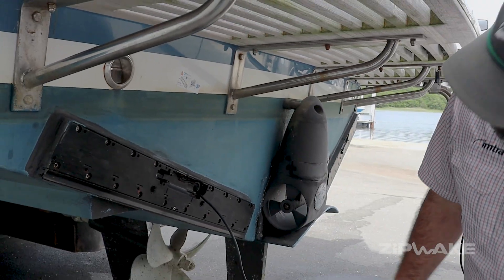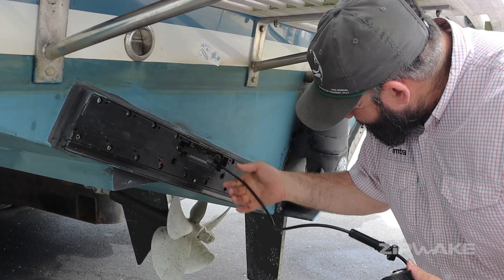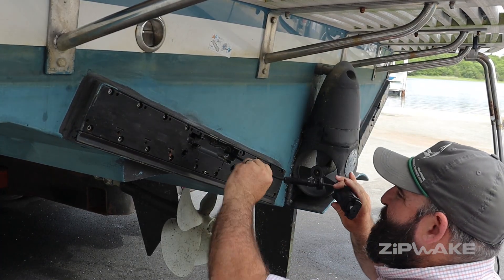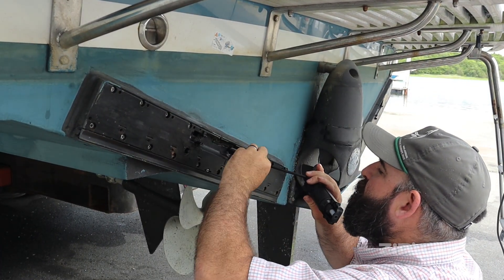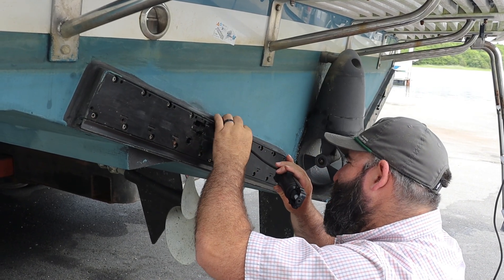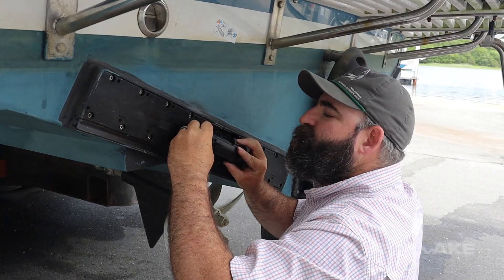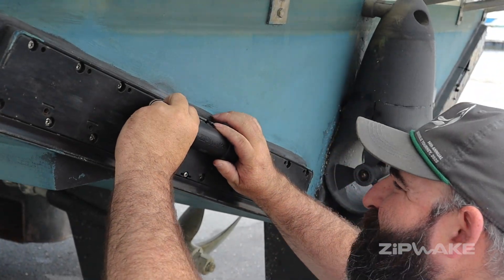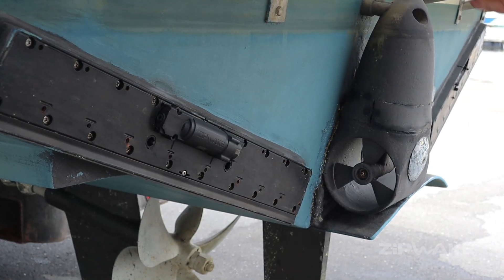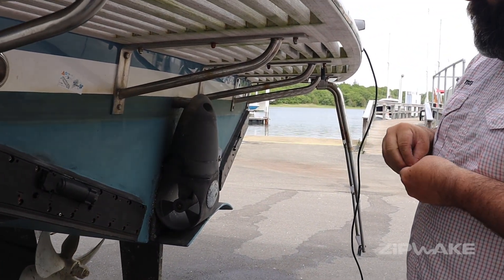This is an out-the-back through-hole installation, so we're going to run our wire through here. There's a little channel behind the servo — make sure your servo cable is perfectly lined up in there, then slide that through and run the servo down in there. Make sure that carrier is perfectly slotted with the back plate and the drive shaft — everything should fit nice and smooth. Any binding, or if it doesn't feel right, your carrier is probably in the wrong position or your cable is bound up.